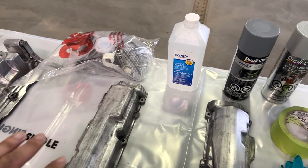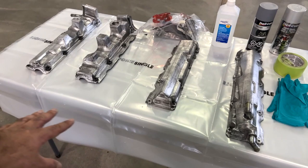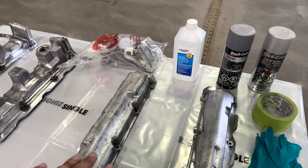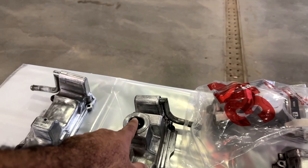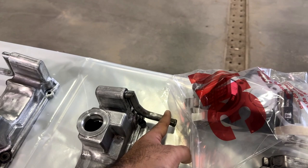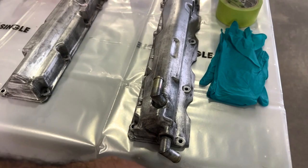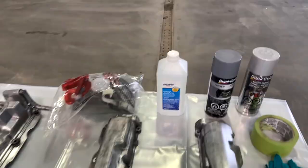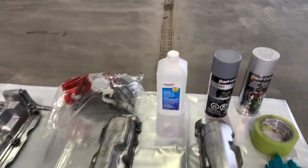For how your paint comes out, it's all in the preparation. Now I'm going to use some isopropyl alcohol — great to use before applying paint, not even 10 bucks for a liter. I'm going to wipe everything down; it gets rid of any grease and oils and evaporates really quickly — the higher the percentage the better. I put on clean gloves, laid down a clean plastic sheet, and once that dries I'll wear a respirator and tape off just the pipe tips where the silicone hose is going.